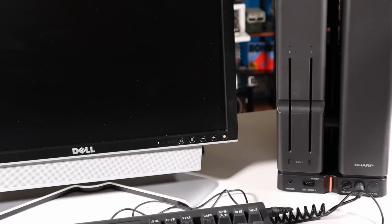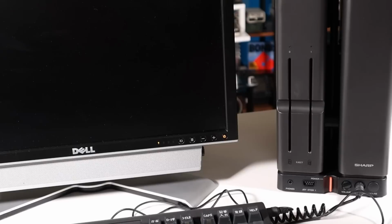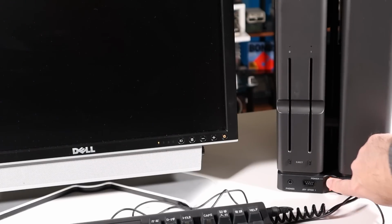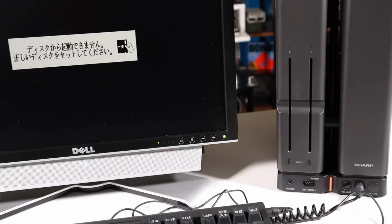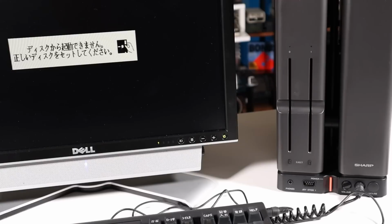They were on for the entire life cycle of the machine in this standby mode where they were energized, but the system was off. So that may play a role in why the power supplies are so prone to failure these days. And what happens if we turn it back on, I wonder? I can't imagine that it resumes. There's no hard drive, there's no non-volatile memory. Yeah, it's back to the boot state. So no resume, just soft power off.